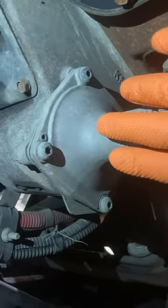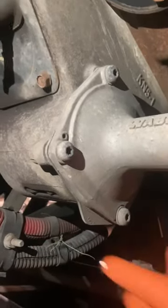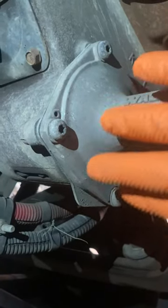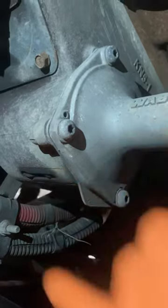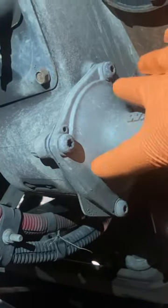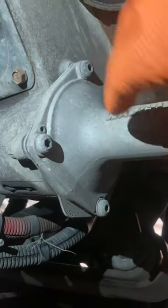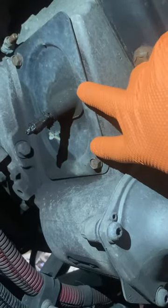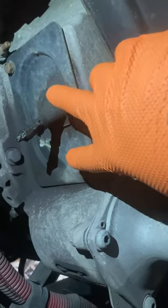Only tricky part about this is that a lot of times your engine will be leaking oil or your rear main seal will be leaking oil, and sometimes that'll come out of this hole and it will maybe look like this could be leaking, but it's really hard to tell if your slave cylinder is leaking by just seeing fluid here. I wouldn't say that's a clear indication that something's wrong here. You might have to pull these four Torx head bolts off and pull this out and check the actual rubber boot and the slave cylinder itself. But that's not the most common failures I see. Mainly the common failures are in here with your clutch brake and your actual clutch itself. So I'm going to remove this access panel and we're gonna look at how to check the clutch brake and the clutch for wear.